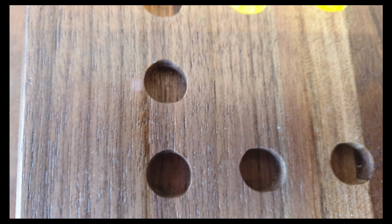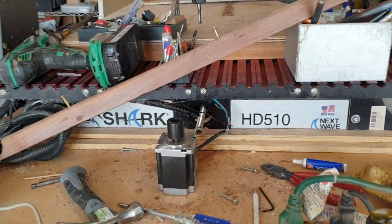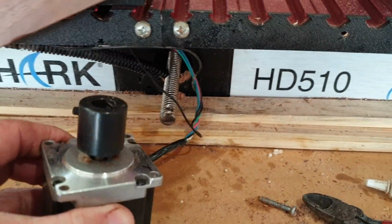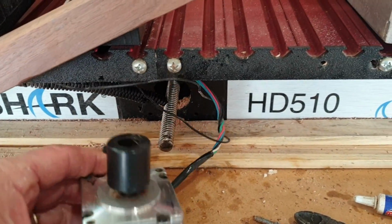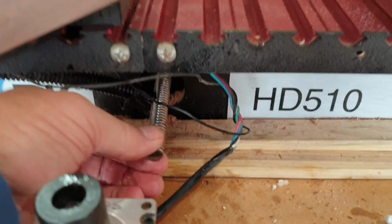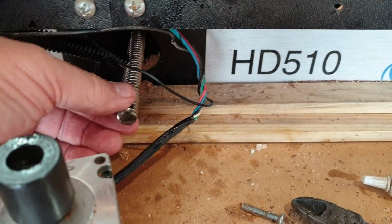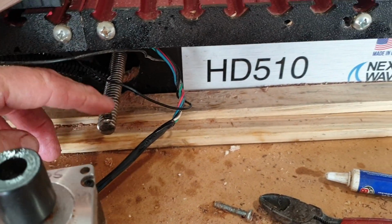And anyway, I did come up with a resolution for that, and here is the process that I went through to get there. All right. Well, I backed the screws out of the mounting plate, where those 4 screws are, and then slid my gantry down this way. I put a clamp on it because it's rolling backwards on me. And then I worked hard at getting this Allen wrench out of there, and it fits over that shaft right there in that corner, straight down in that hole.